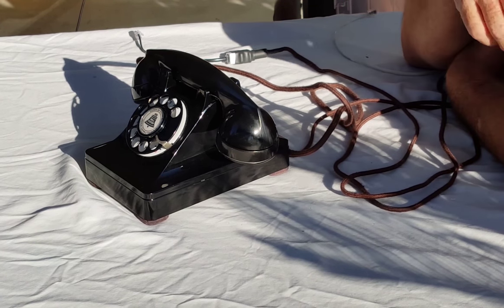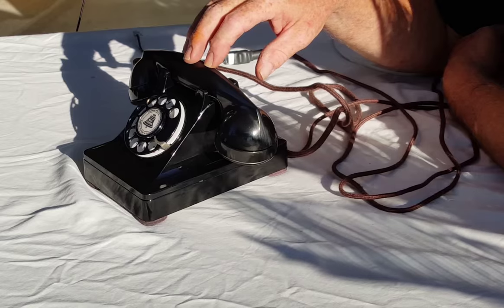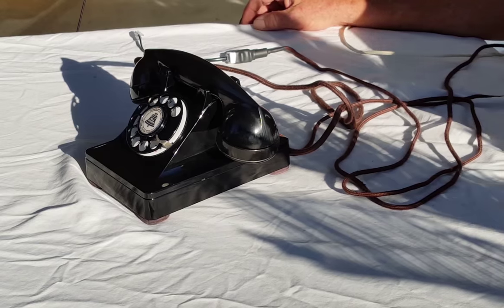Some, if not all, VoIP systems will not work with rotary pulse dialing telephone systems, the telephone service provider. So you must have rotary pulse dial service. You can get some devices that will hook up to your cell phone and via Bluetooth will hook up to the backside of your house wiring, so that now you can use rotary pulse dial telephones with a cell phone service. You can research that on the internet. You can Google it if you have trouble finding it, or that you just don't know how to research it. You can drop me a line at telcosteve@gmail.com. That's telcosteve@gmail.com. And I will assist you with the name of the manufacturer that I know of that can do that. I don't endorse them. Let's just get that out of the way. I simply know that some people have done that and they say it works great.